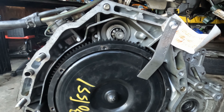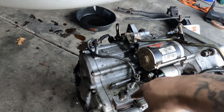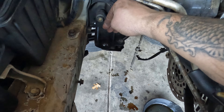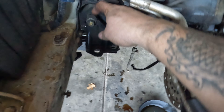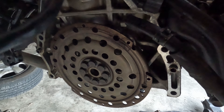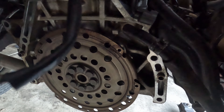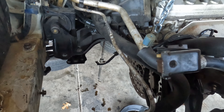Here's a better view of the torque converter. There are eight 10 millimeter bolts that go right here. Here's where your mount goes. I like to take the mount itself off of the transmission instead of the main bolt — that way, when it comes out it gives you a little bit more room because if it tilts too much you're going to have to clear the top of the bracket from the side of the car. This is what the back of the engine looks like — that's your flywheel or flex plate, and the torque converter bolts through these little holes right there.